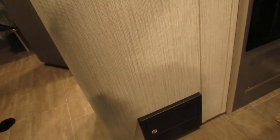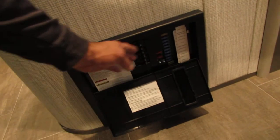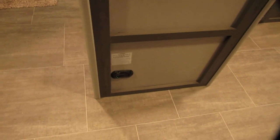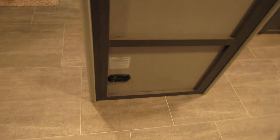Fuse box, breaker box — if you see a red light on in the window, that's the fuse that's blown. Everything's labeled real nice with your breakers. So if the microwave or anything outside is not working, go to your GFI switch, which is probably located in the bathroom. The LPCO detector will detect and beep every 20 to 30 seconds when the unit gets low on battery.